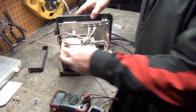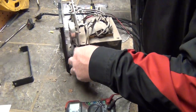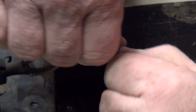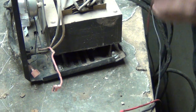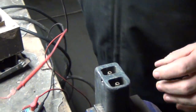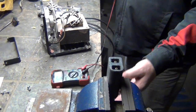The other most important thing — we talked about the wire being bad down there. You've got to find it here first. It's this little wire that's inside the handle. That belongs to that little clip — just reach in and touch that little clip. A lot of the trouble is in this handle right here. If you do not have continuity there, you've got to rewire this handle.